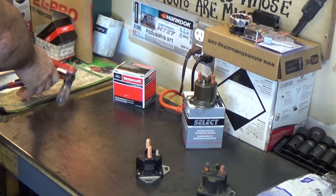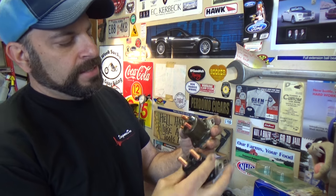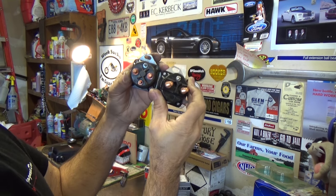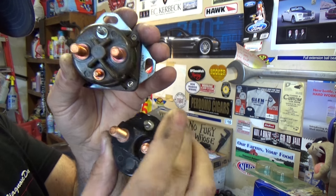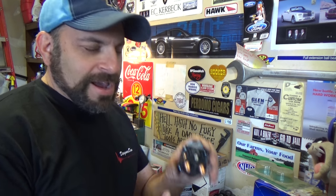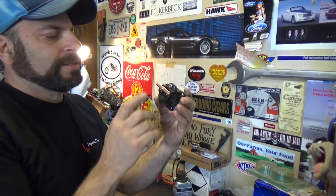One more thing before we go back to the truck: the way this is molded. The backing plates are pretty much the same — they look good. But as far as these terminals where you slip your connectors over, the BWD has this plastic doohickey right there where this one — the OEM — doesn't. And this thing was really in the way of getting those terminals on. I told you about it earlier in the video. I had this junk on, took it off, and put the old one back on and jumped it because I couldn't trust this thing at all. Keep in mind the OEM doesn't have that, so your wires and connectors are going to fit much better.